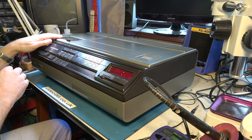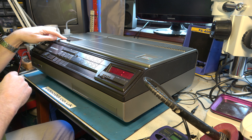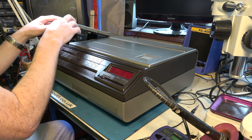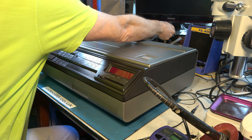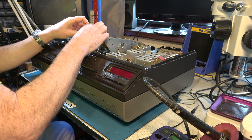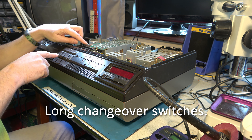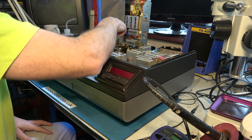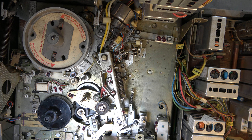When we left this, the situation was that when it powers up the clock works, and when the cassette carriage is installed the head drum spins and the reel motors spin. So let's power it up again. You can hear the drum spinning and the motors are spinning, and it won't shut down. Probably it's trying to unlace and doesn't think it's quite managed to do so, though normally if it couldn't unlace it wouldn't allow ejection, so that's a little odd.